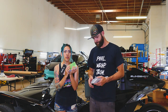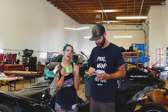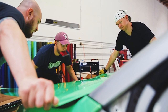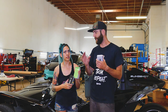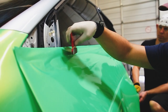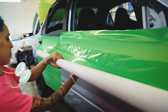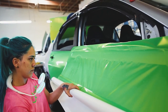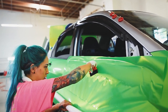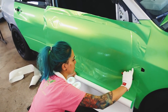The second part of installing with this film: it has great air release — it lays down really nicely, similar to cast film. But it is a higher tack, so I don't recommend full-pulling films and glassing out panels. It's pretty tacky, especially in a warm shop, and it can create adhesive lines. You want to do a roll-down method, or have two people installing together — one person holding the film to keep tension, one person squeegeeing down. That's the cleanest way without getting glue lines and without fighting the material. If you tried to full-pull a hood with this by yourself, it's going to look like garbage. Treat it like the high-tack material that it is.